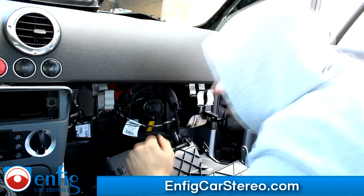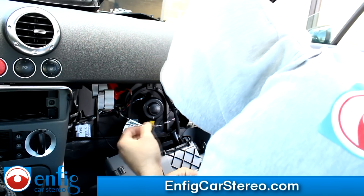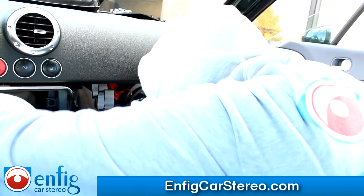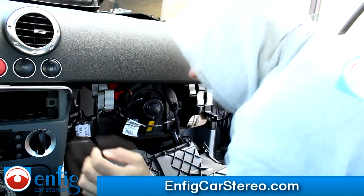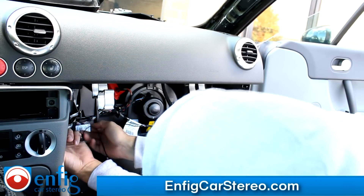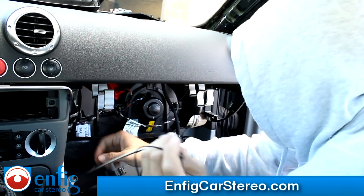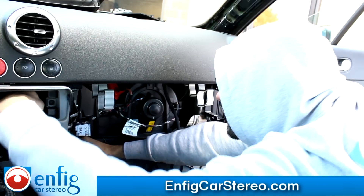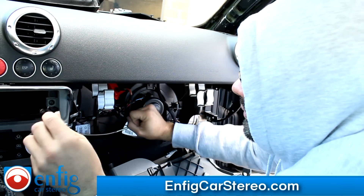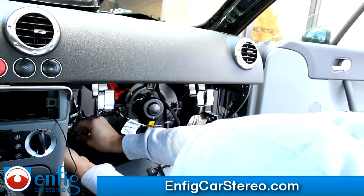You could have snuck it behind here, but the route to get to the back of this is not super easy to do — some of you just won't be able to do it. I try to do my videos easy enough where everyone can do them. Actually, I don't know how I pulled that off, but it's a tight little cavity here. Next thing I'm going to do is grab my gravity tool. There are two big air vents here — stick the wire between the two air vents, directly in front of the metal, and it comes up really easy. Make sure you're behind everything so when you put everything back together it doesn't catch anything.